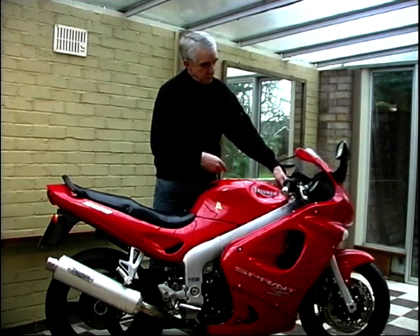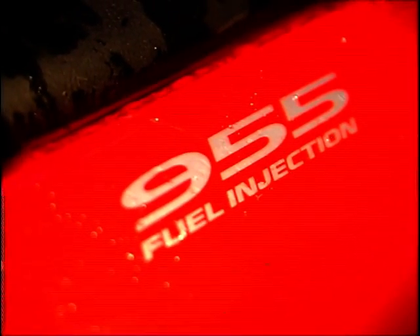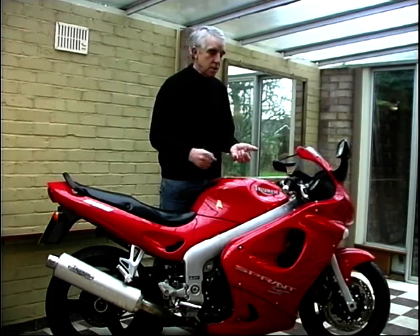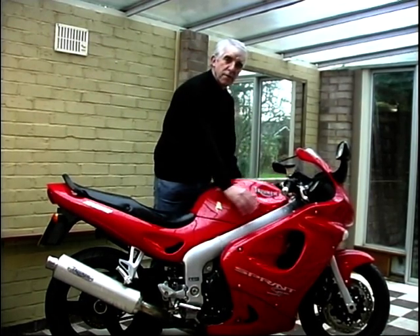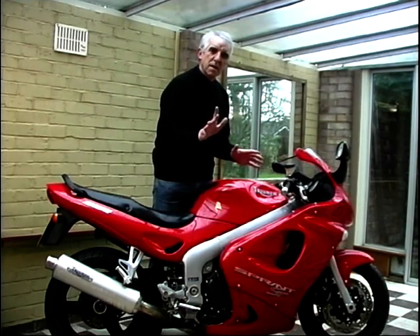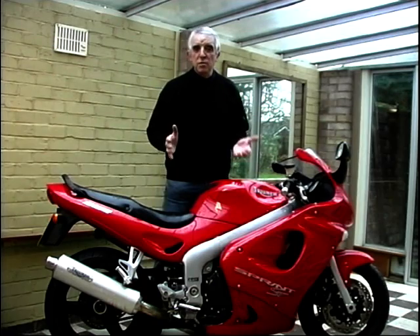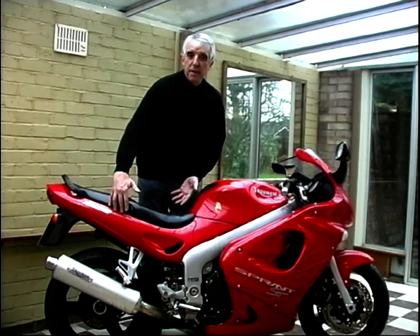Aluminium sections ribbed internally to give you extra strength. They've done that to get rid of the old steel spine frame — it used to run up from the headstock down to the bottom. You've now got a fuel-injected motor; they needed more space for that. And they wanted to make it subtly different from its sexy cousins, the 509 and the Daytona, which has got those oval tube frames. They also needed to beef it up because this bike will be used a lot for two-up touring, so by making it stronger here, you can also put a stronger subframe on.